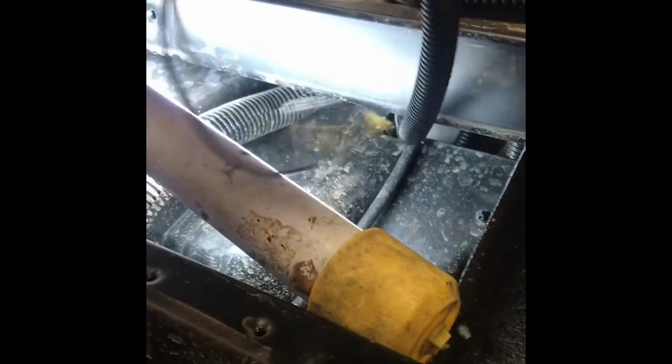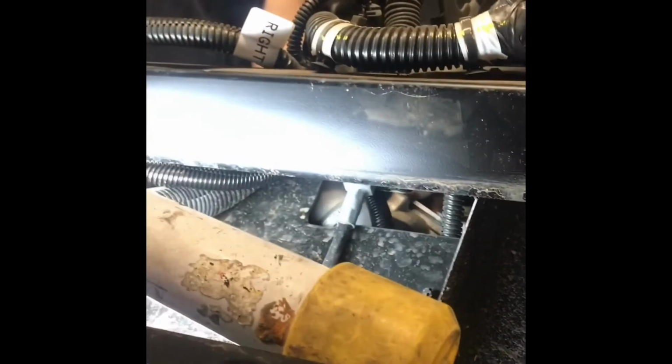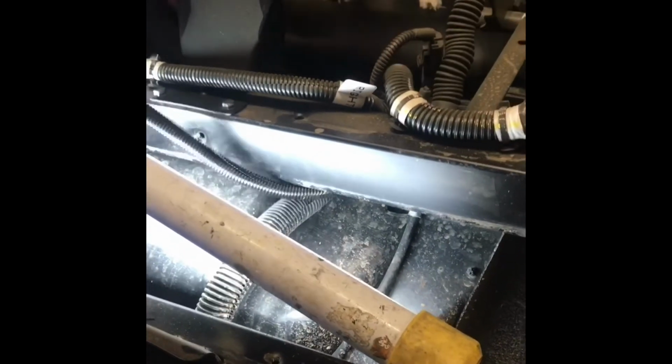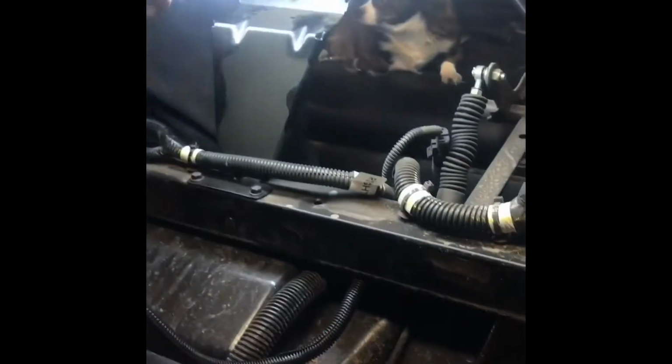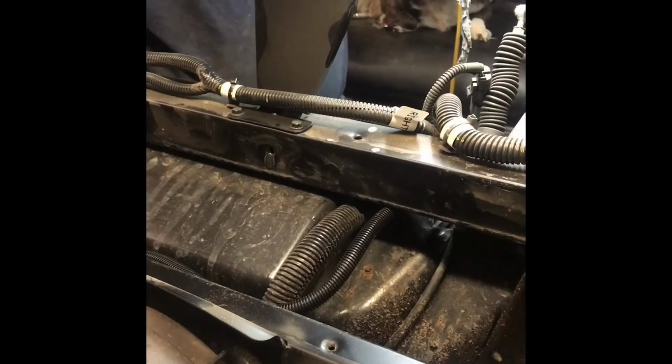If you feel cold air coming up through the steering column, that's where the cold air is coming through, this open exposed hole. It's not sealed off from Polaris, so that's what we're going to do, is run it through there, and then we're all done, and seal it up, and then you won't get that cold air coming through your steering column. It's just going to run underneath the cowling and over here.